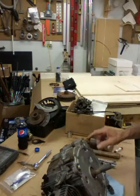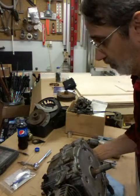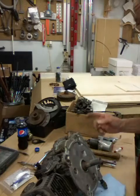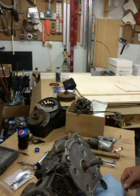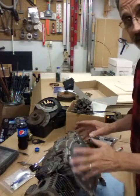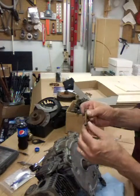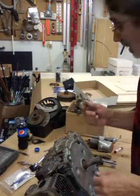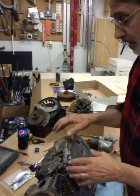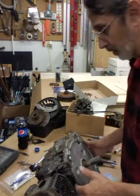Now we can take the bottom off, pull the crank, and look at the crank and the connecting rod — all the internal parts. We got all of them out and by the looks of them, they had Loctite on them and they came out pretty hard. Before I put this back together, I'll run a tap through these holes and clean them all out so the bolts go in a little better.